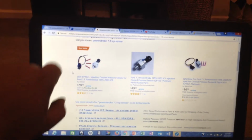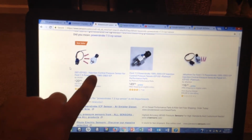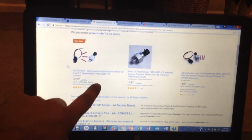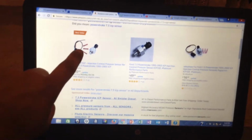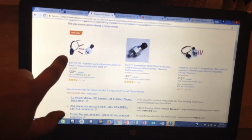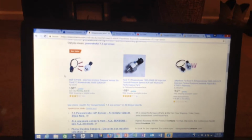Plus, this is the one that I would choose if I was buying this. It's made by DEF, ICP sensor here. I'm going to leave a link in the description to this Amazon part. The reason why I like this one so much is because it has the sensor, but it also has the pigtail. A common problem with these is that the leaking oil destroys the pigtail. So it's a replacement pigtail with your connectors, everything you need to replace that. That's why I would choose that one. It's because it comes with the pigtail.